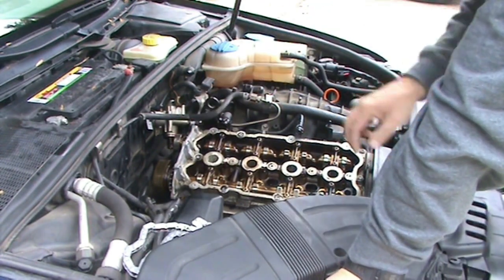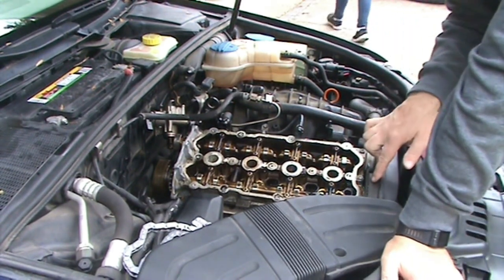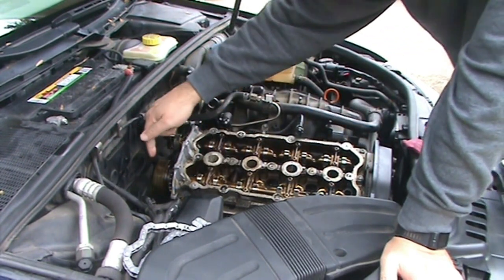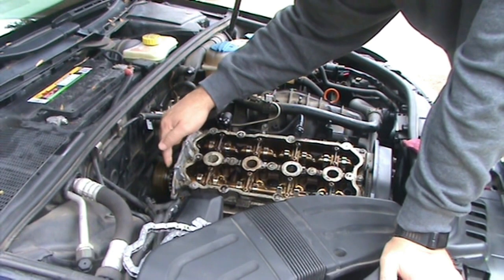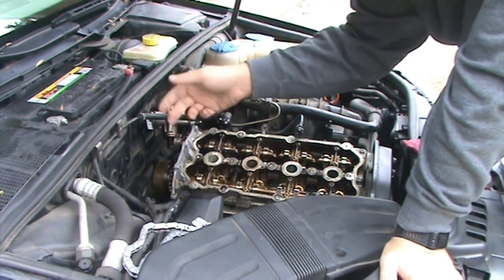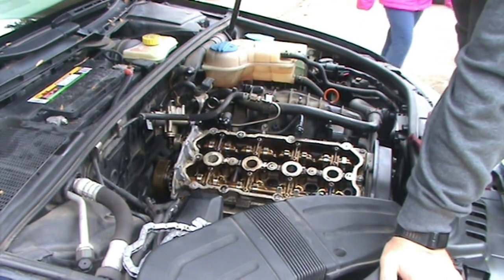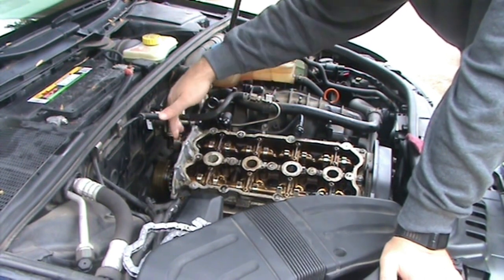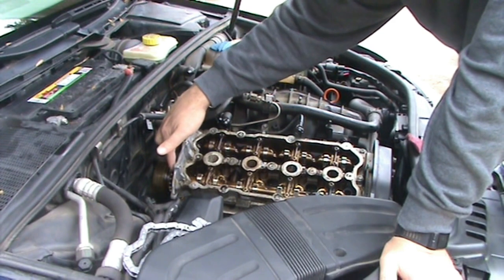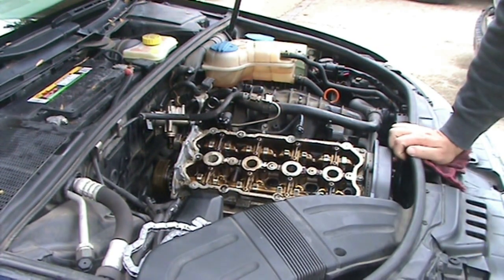It's kind of weird because on the front up here, you have a timing belt, which goes from the crankshaft up to the exhaust cam. So power comes to here, rotates this cam, and then you have the variable timing unit back here that adjusts based on oil pressure, RPMs and all that, to set up what your intake timing is. That cam is driving the chain that connects the VVT to the intake cam. It's a really weird setup.